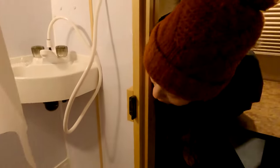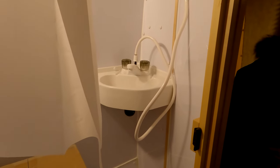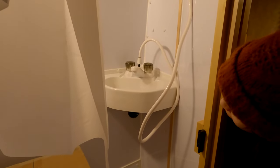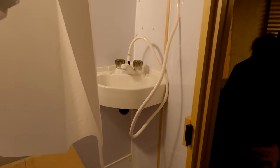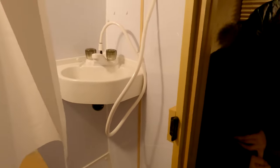Always make sure the exhaust fan is pulled down when traveling. This is your shower slash sink. You have to turn on your sink to be able to use your shower — right in between your hot and cold there's a little white piece; you're going to lift it up like you would at home and the water will come out of the shower. This is not a gravity-fed system, so when taking a shower you will have to turn on the drain pump, which is located right underneath the light. That pulls the water back to the gray tank.